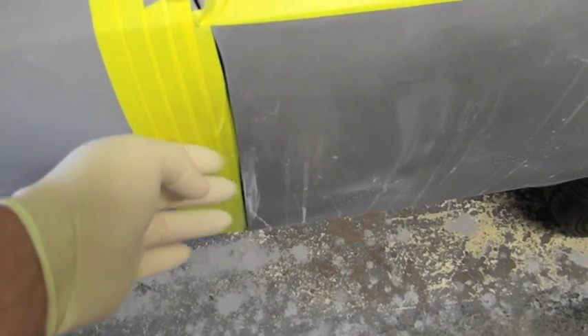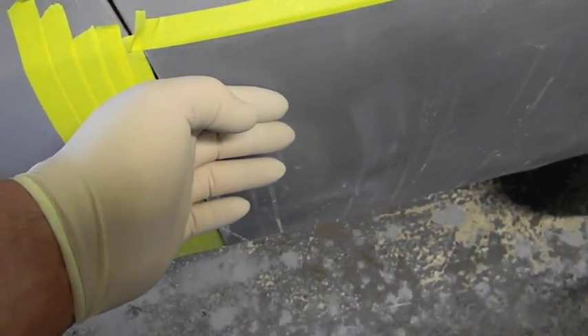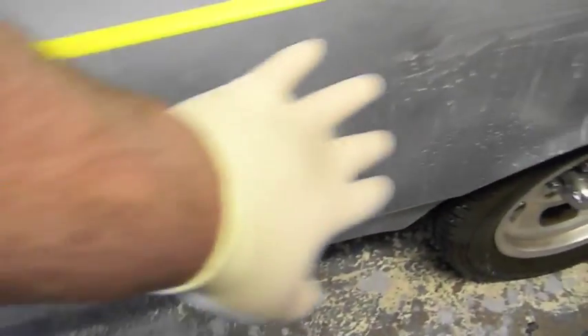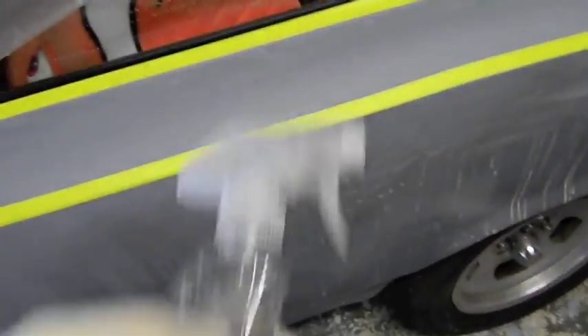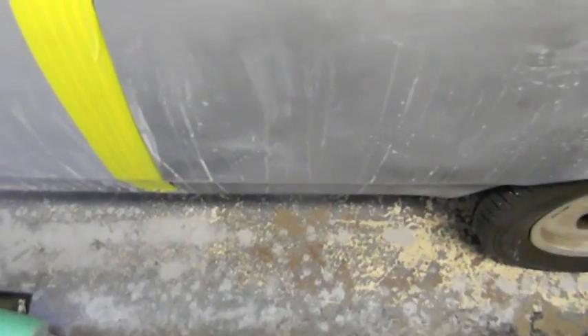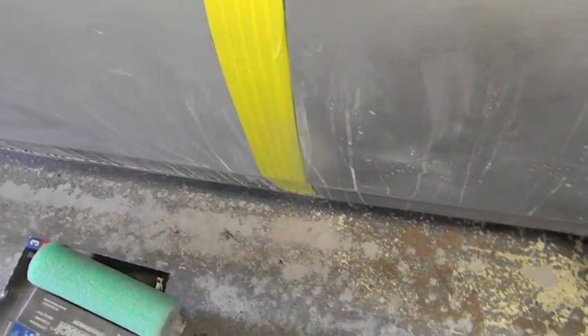Got the same going on down here. I masked the adjacent panel — in this case there's no door seal, so it is a little pushed in and lined up, so I'm pretty safe. While I'm doing this and putting my efforts here, I don't want to think about that. We're just going to do the front part here. Some of the things you need when you wet sand: you could use a spray bottle full of water, an old dishwasher detergent bottle with a spout, or run the hose if you're going heavy.